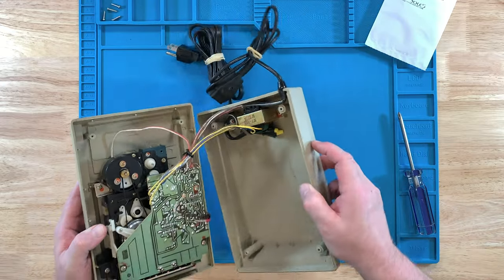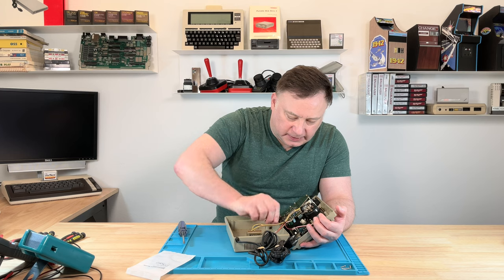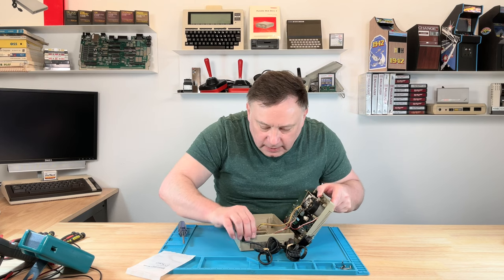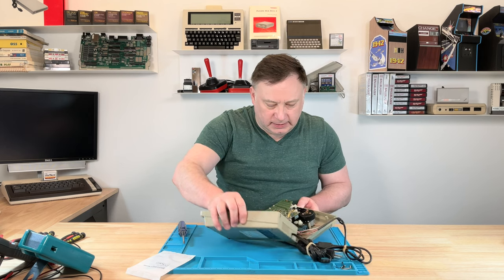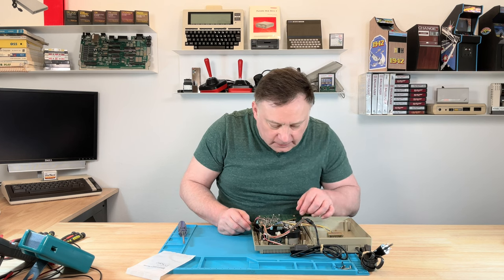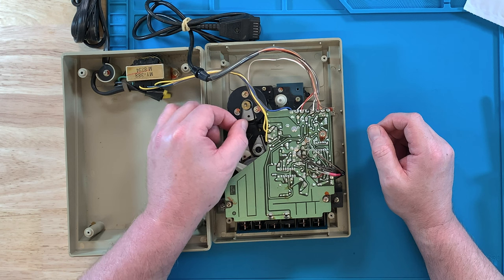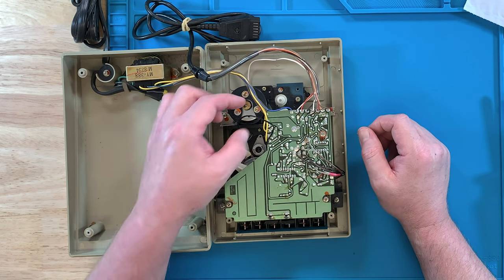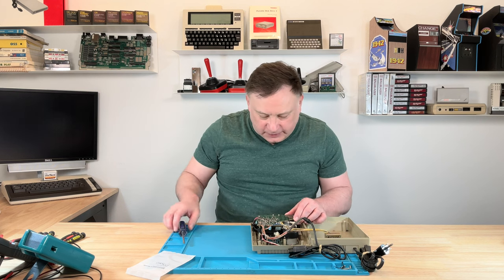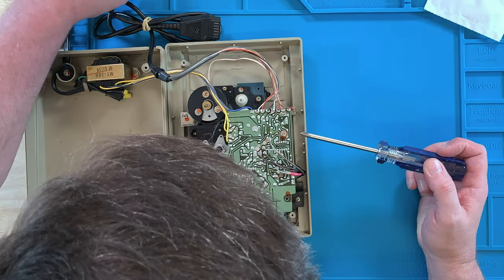It's a little gross in there. Let's see if I can do this without taking the transformer out — I'll wipe the case out a little bit later. Already we can see the first belt: it's all loose and it's got kinks in it. You can see it's not smooth and straight anymore. For any of these tape devices for any computer, the belts — unless it's direct drive — just get old, dry up, crack, stretch, and kink.